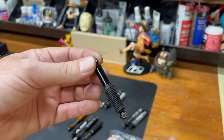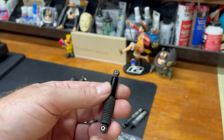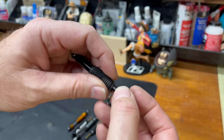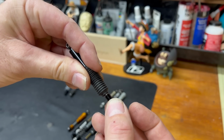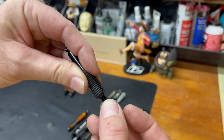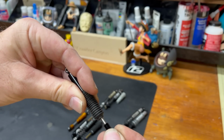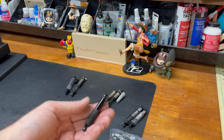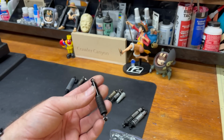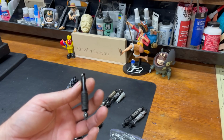When I ordered these and put them on, I was like, oh, they're the same exact shock. Are they a high-performance shock? No. Do they have to be filled with differential fluid? Yes. These have 7,000 CST oil in them to give them any sort of damping at all. And you'll watch, shock goes in, and then you'll get a point where it just kind of drops past. We're getting the emulsion back in a little better, but these go on a leafer, so we're not trying to obtain the absolute optimum in performance.